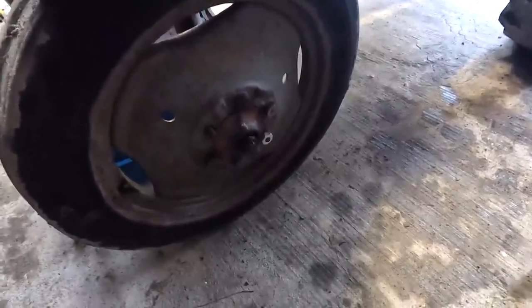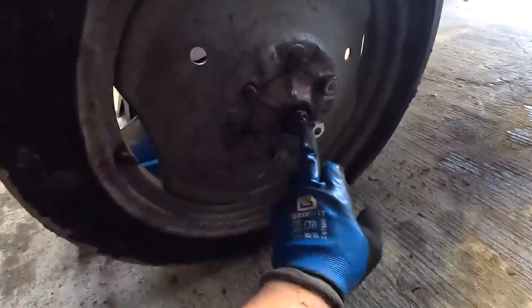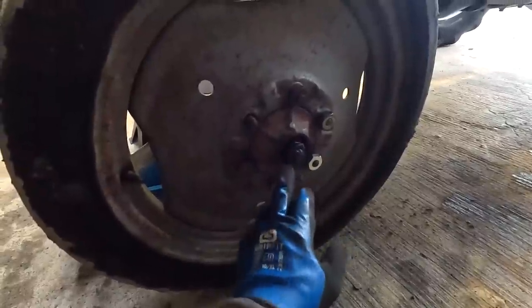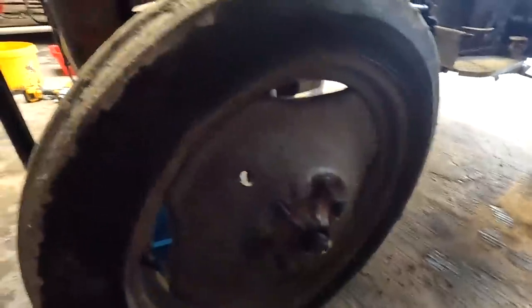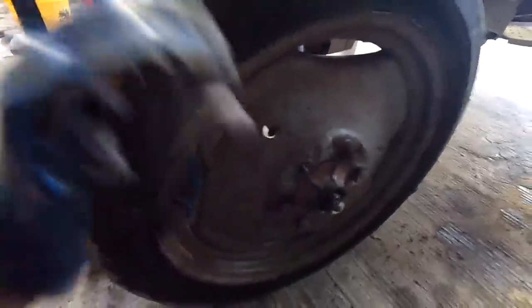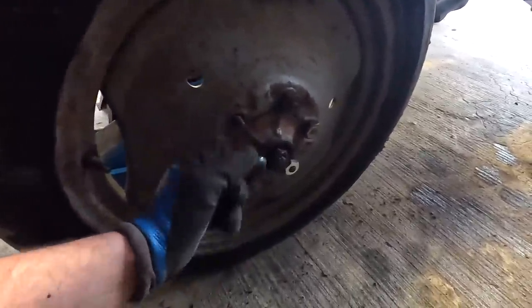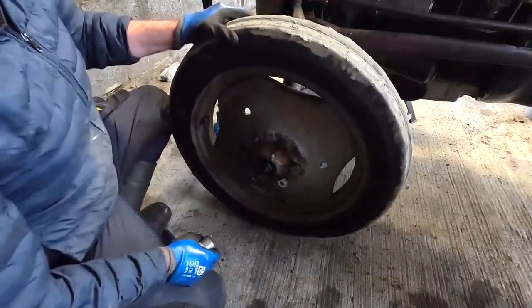We're on the far side here - sorry about the dark. The very same thing with this wheel: a little bit of movement, and this here is loose - I can move it back and forth with my hand. I'm going to do the very same thing again. There's actually no split pin in this one and that's a disaster - that's probably the main reason why it loosened. I also need to put two complete new studs in both wheels because someone has welded them from behind and it looks horrendous. But for now, tightening it up - that's the movement gone.